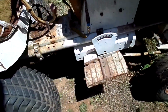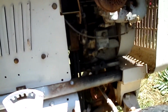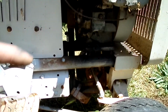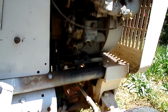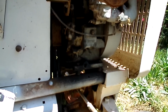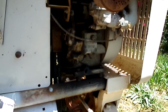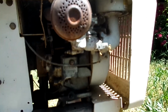Now, I looked it up, and this tractor has been sitting a little bit longer than I remembered. It was actually 5 years since I've run this. I wasn't shooting video back then, but I did get a couple of still shots I'll post in here. The carburetor was hilarious. I mean, most of us know not to use RTV sealant on a carburetor, but the person that worked on this before not only used RTV, they used almost a whole bottle of it. The stuff was in the bowl, it was in the jets, it was in the passages. I mean, it was just full of that crappy blue RTV. So, I'll post those pictures. Might get a laugh out of that.